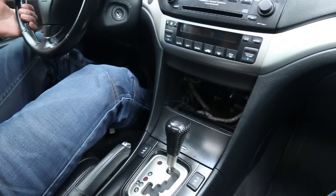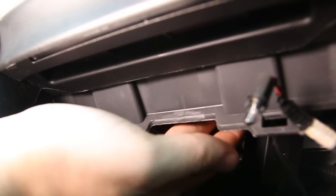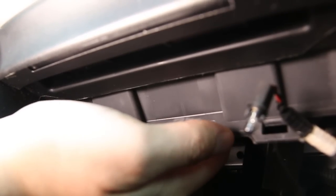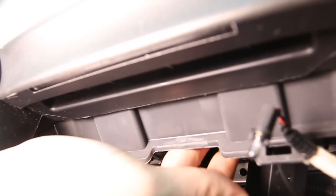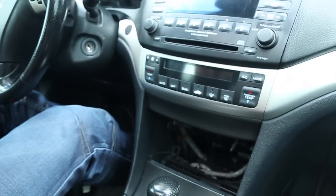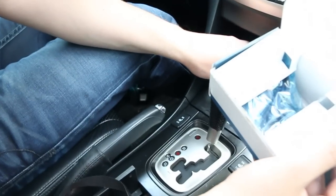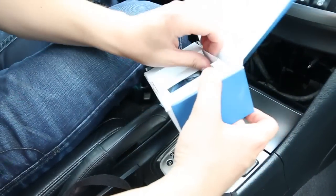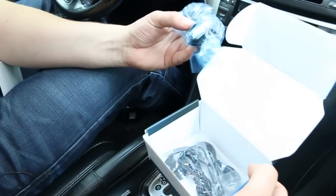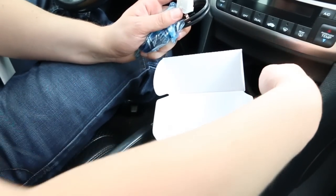Once you do that we're going to look underneath the radio. Right underneath the radio there's a connection that we're going to plug our harness into from our GTA Car Kits Pure Bluetooth — it's hard to see on camera but it's there. So once you remove that, we're going to show you what comes in the kit. You have the module which is going to get hidden behind this pocket, and then we have a harness cable which will plug in right underneath the radio — it has the exact same connection right underneath there.